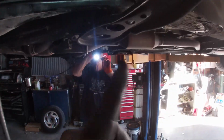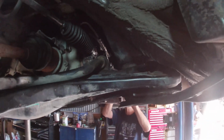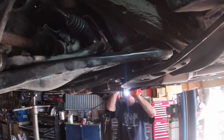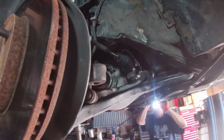Same concept as before, just reached up right here. Even the nut has a tab on it, see, so it's supposed to catch and allow you to take it out. Wasn't working, so he stood there and held it with a wrench. But this is certainly his problem right here. That bushing is completely shot, but it's also leaking everywhere. So once we get the other side free, then we'll take these lines off, and then it's all about fishing it out of this hole right here and trying to fish the new one in.